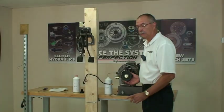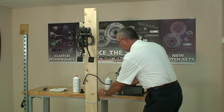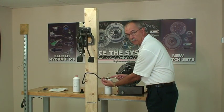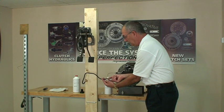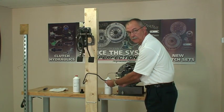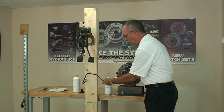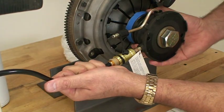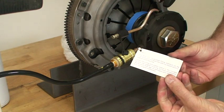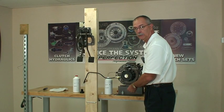Now from underneath the vehicle to make the installation, remove the shipping plug from the new, improved, upgraded connection system. We're just going to take the line. This would be the correct time to replace the O-ring and the sleeve if you bought a new master cylinder — make sure the O-ring doesn't have any nicks in it because that's part of your sealing system. Push it into the connection, one good click, just push it in, give it a little pull, make sure it's locked in. We've also got a hang tag on that system to give you further instructions about how to service this.